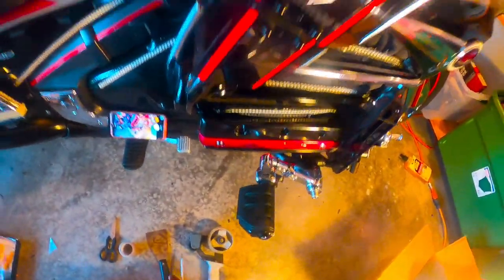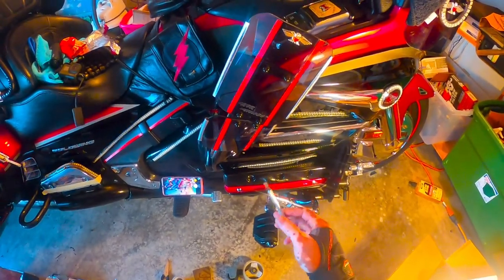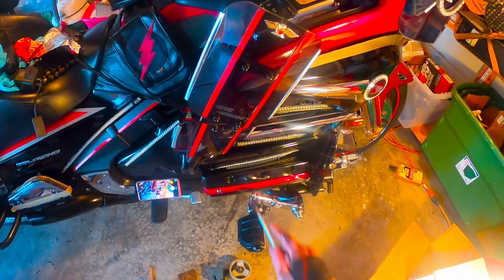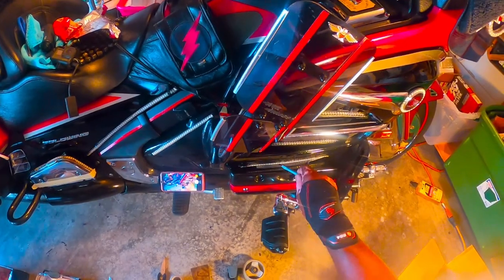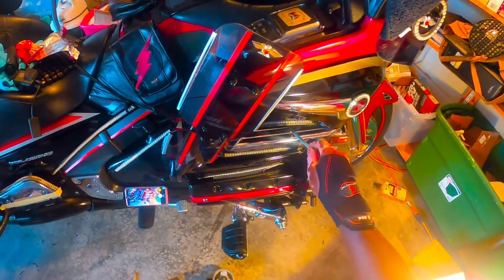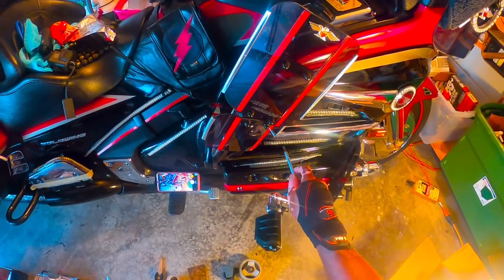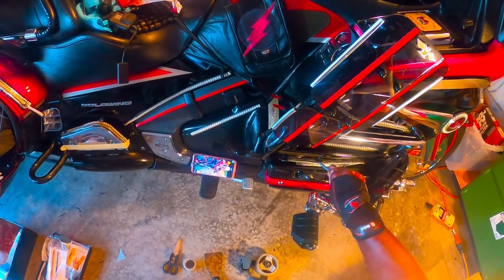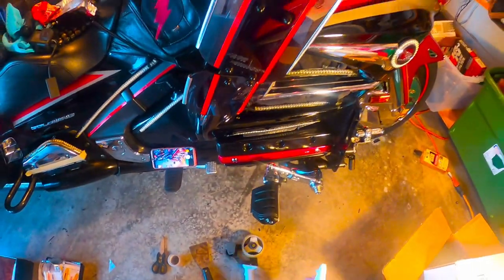All right, take your small razor blade, and kind of just slide it up under the LEDs. All you're trying to do is create an opening so that gas can get behind there and start eating up this adhesive. Okay, just go make one in the middle, make one at the end, and alternate like that. Okay, as you can see, it's starting to come out.